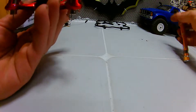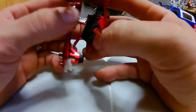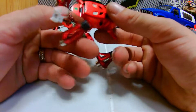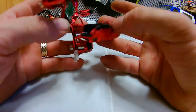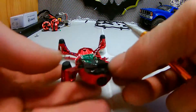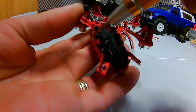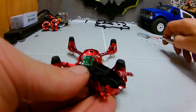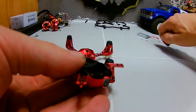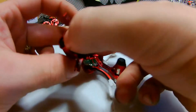Make sure your battery is out — take that out. We should just be able to pull that apart. Don't pull too hard though because the camera connection is there. Right, inside this there are four screws — take these out. This piece should pop out.